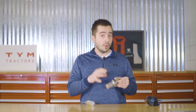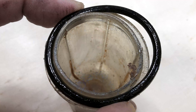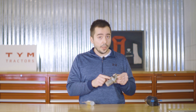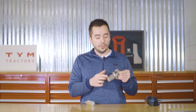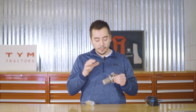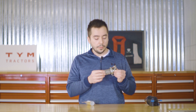I'm going to open this and we'll splice it in later. A common problem with this fuel system — and when we started making these videos I said I'd tell it how it is, the good and the bad — this has a common problem with the O-ring that's under here. We'll take it apart and splice it in, but this O-ring will expand. It's not the best rubber. It will expand, it will not seal, and this can cause all kinds of issues. One, you can suck air through here — your engine will lose power, it'll smoke, all kinds of issues. It can also break like any other O-ring, and we've also seen some deformations of the actual bowl itself. This is a super easy part to replace, and there are even aftermarket options, but it's something to keep an eye on. If this O-ring is bad, this filter's bad, or this bowl is warped, it can be causing problems with your Kukje engine.